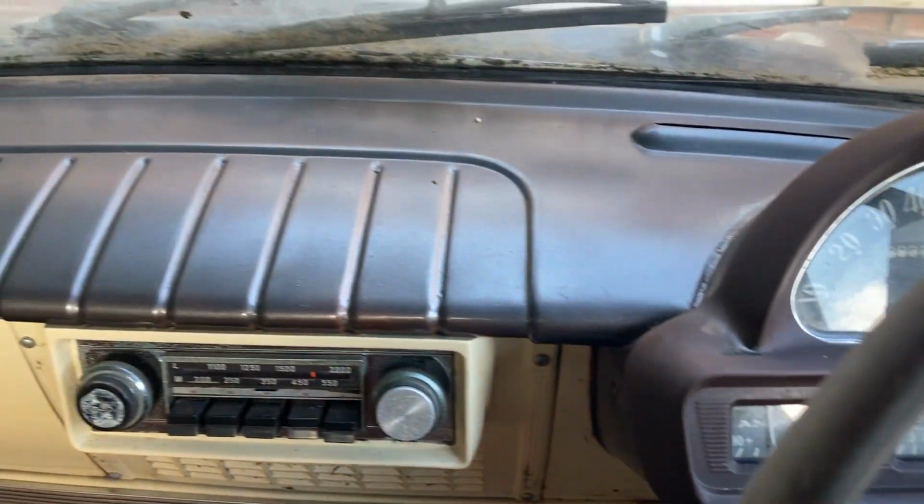But mechanically, they were still the same as the old ones, using the tried and tested 2.1 litre, 2088cc to be exact, Standard engine, which was a very, very good engine. Wet liner 4-cylinder. Very rugged, very tough. Saw service in the Standard Vanguard, Triumph Renown, TR sports cars, and also a slightly different version in the Ferguson tractor. So they were an extremely good engine, tough, durable, rugged, and about 68 brake horsepower, which is pretty lively.